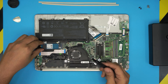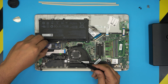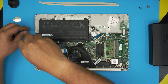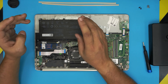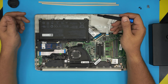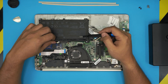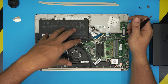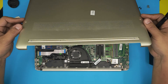This slot is compatible with M.2 — it doesn't have to be NVMe, but NVMe drives are much faster. You do not need to remove the battery to do this upgrade. But if you want to, remove all the chrome screws touching the battery and lift it off the contact on the board. Just note: if you do remove the battery and turn the laptop back on, it will say the BIOS was reset and you'll need to reconfigure your date and time.